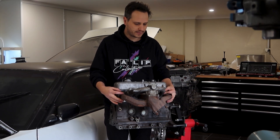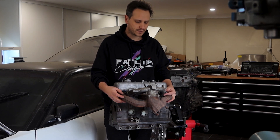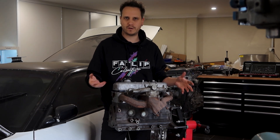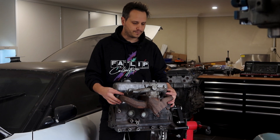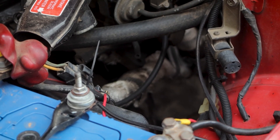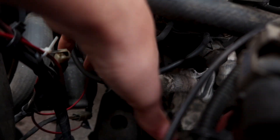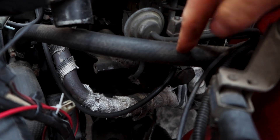J-pipes can work pretty well. There are a lot of benefits to keeping a factory cast manifold — usually thicker wall, usually better flow — and when you're not running a full-on race engine, it's usually fine. They don't look as nice and they usually require more room, so when you do a custom install you can pretty much put the turbo wherever you want and make the manifold to suit, which is what I plan to do on the K25. But for the K70 it's a budget race car. So I will remove the existing heat-wrapped extractors, put the factory manifold back on, and run a J-pipe off of there. You can see the bottom of the intake manifold — the exhaust manifold will bolt to it and then come out sort of around here from memory.